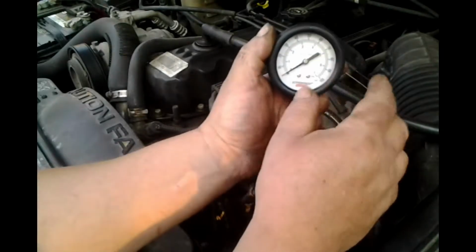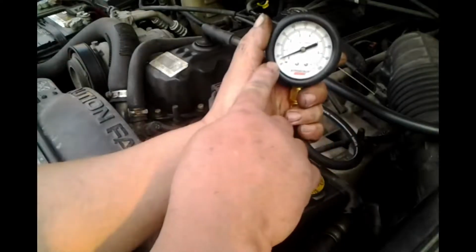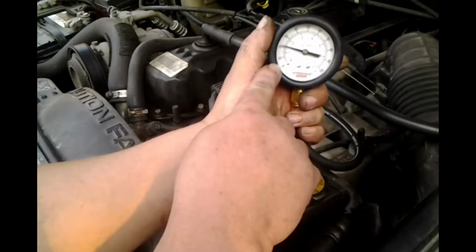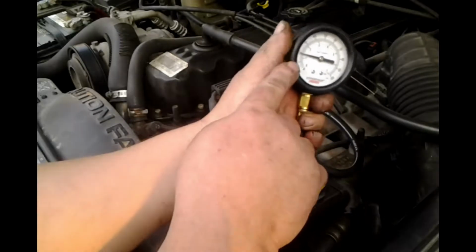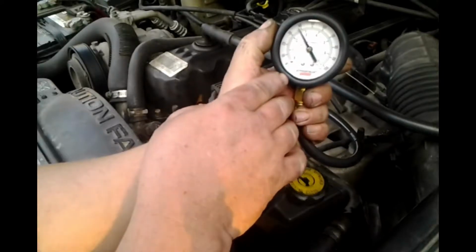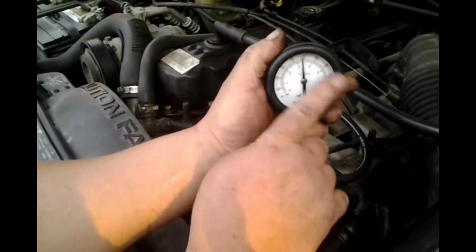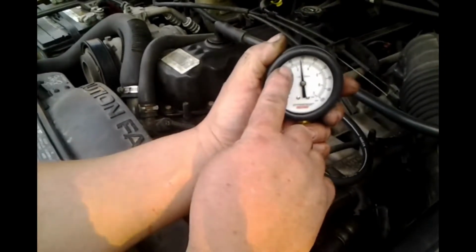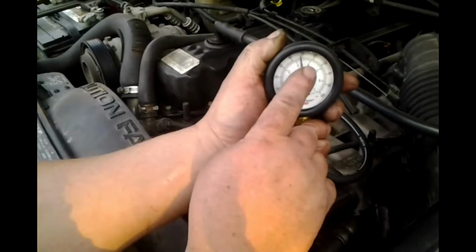You know what? Give her a couple cycles through. Oh, there's coming up a little bit. But you notice it's dropping rather quickly. One more. This time, fire it up. Whoa, easy there. Now, I don't know if you guys noticed, it got to about 40 psi and then fired. The pump should run between 40 and 53 psi.